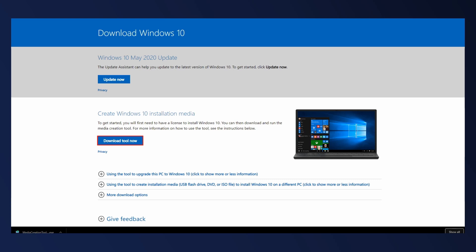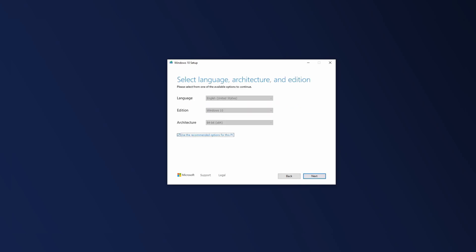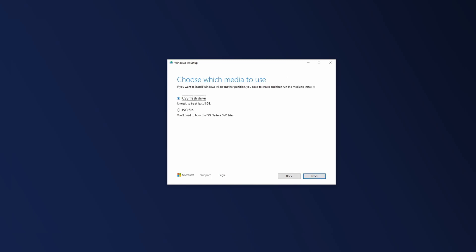Just a little pre-game prep work here. If you want to tear into your all-in-one and replace the hard drive with a new one, before you start upgrading this PC, if you don't have a second Windows PC to do this step, make sure you create a Windows USB installer first. Download the Media Creation Tool from Microsoft — I'll put a link in the description below. Once that's done downloading, launch the Media Creation Tool executable and follow the on-screen prompts to create a USB stick. During the process, just make sure you select USB instead of ISO file, and for this particular PC, we'll need the 64-bit version.